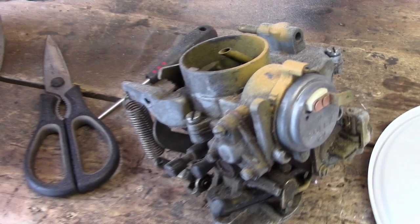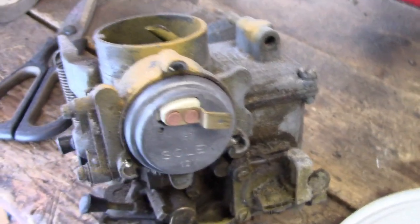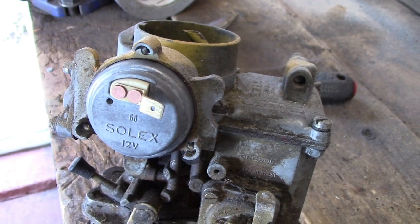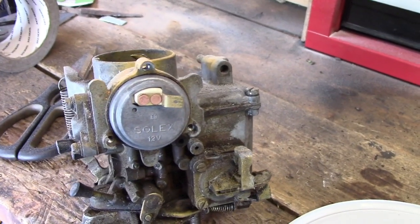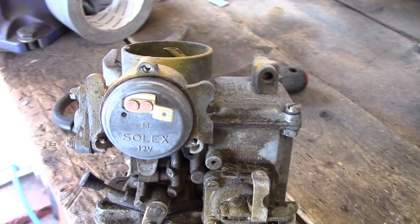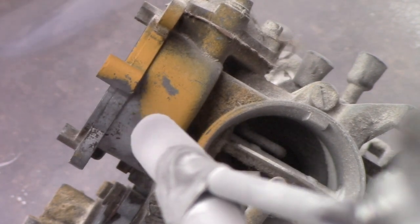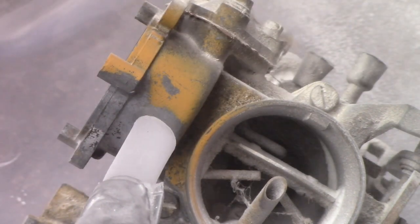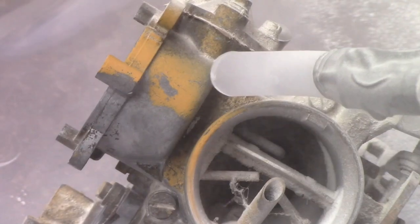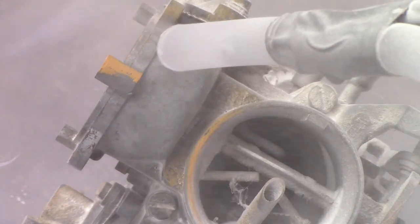Maybe don't do it in a garage unless you've got a blast cabinet, because I've got a fine white layer of dust everywhere at the moment. I'm quite impressed with that. For something that's cost less than 20 quid, I would suggest if you were doing a carb, it might be the way to go forwards, especially if you don't want shiny blingy carbs. I don't like them when they look like they've been chromed — I don't think it looks natural, it wouldn't have come like that from the factory. This is my next go at blasting and the problem I had was that the tube in the soda blasting pot kept coming out, so no soda was coming out. Finding the right distance from the nozzle to the piece you're working on was a bit hit and miss. But when I got it right, you can see how quickly the paint started to come off. The best way to do it was to put my hand on the other end of the tube and just work the soda gradually into the tube, and then all of a sudden — whoosh — it goes.